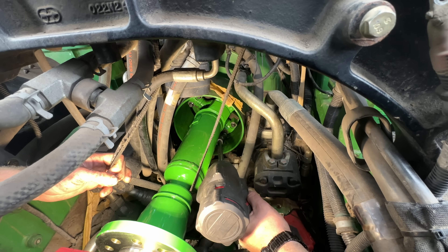Teamwork. Now I'm going to show you how it's supposed to be done — Daniel's going to crawl underneath there and put a bolt on that flywheel at six o'clock. We had to let that shaft back down and turn it with some pliers to get it clocked right, because the way that U-joint was, it wouldn't allow it to flex and make it go that way.